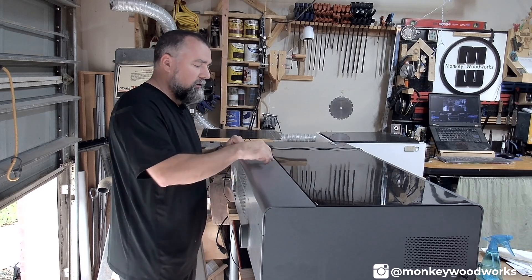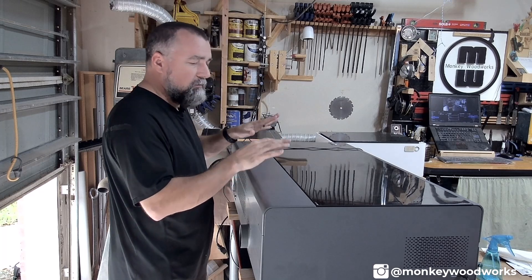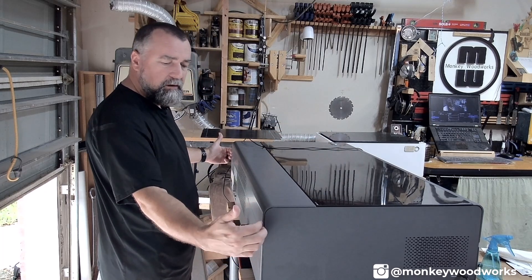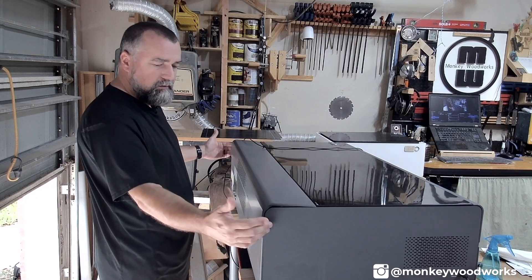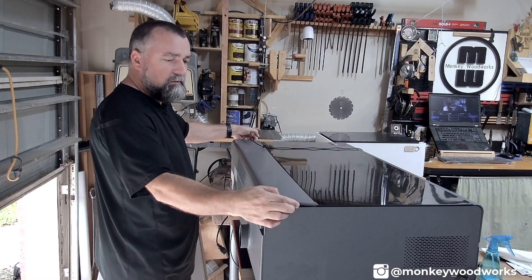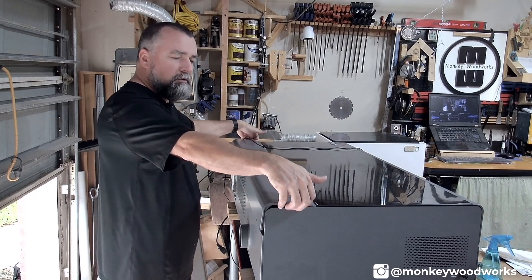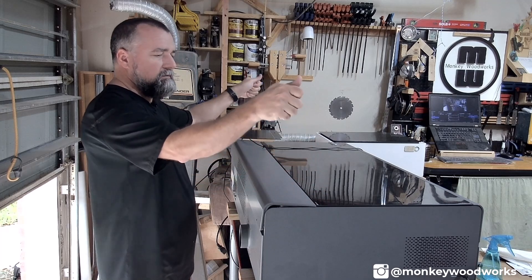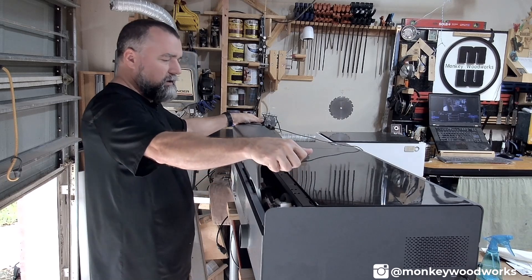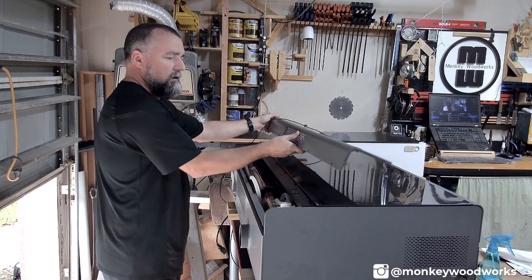This is a little tricky to remove because right here in the front, it wants to bind against the clips that hold it up against the machine. First thing to do is lower the lid and make sure it's closed. Remove the screws, then pull with your fingers the outside edge so it actually flips out. Put your fingers underneath here and here and pull up — that frees the sides. But this is where it's binding in the middle. To free it up in the middle, put your fingers in here and twist and wiggle as you're lifting up. That'll make it pop out of there.